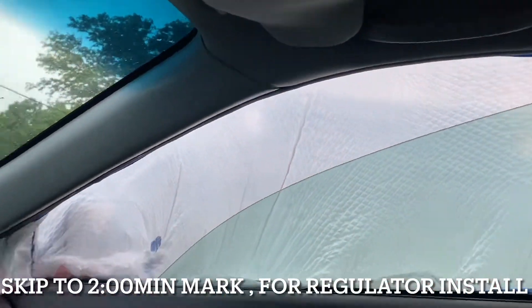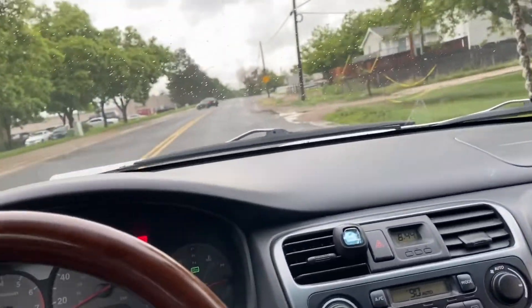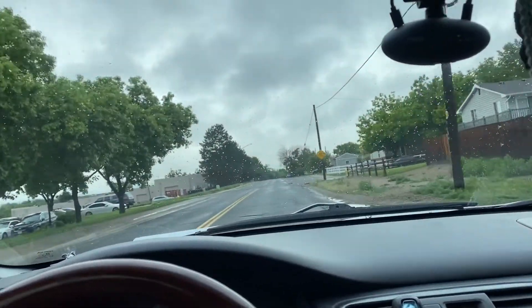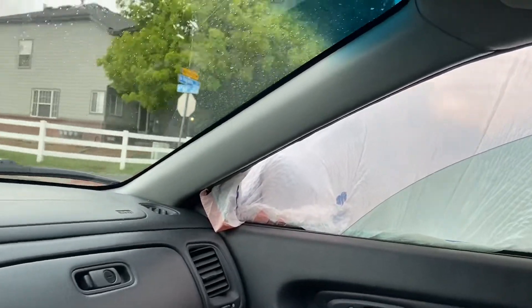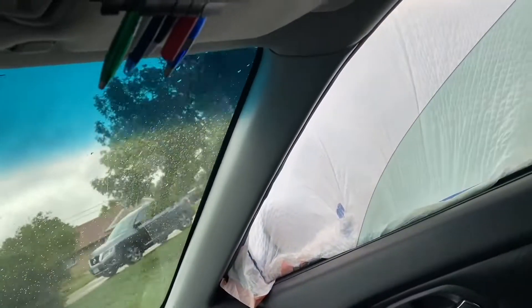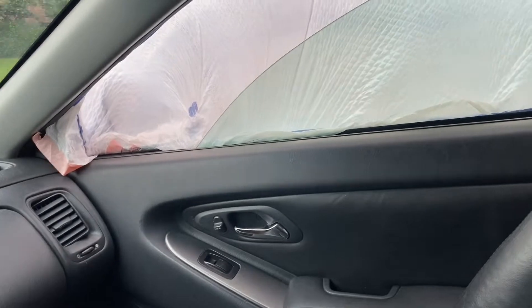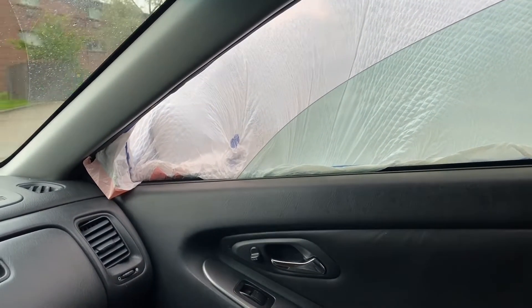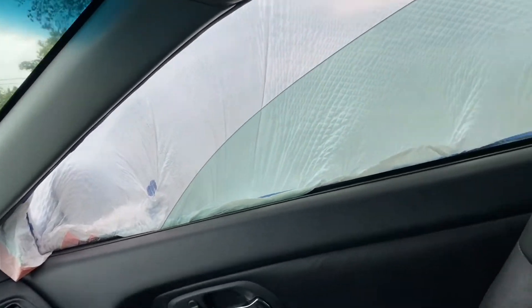Day in the life, taking the side streets over to my dad's. It keeps raining bad, raining slow, raining bad. So I put a bag on the window — I don't even have duct tape, that's why I'm on side roads. I had painter's tape. I could hear air getting through. I was trying to show what the window regulator sounds like when it's going out — like a machine gun basically. She snapped on me yesterday; I was holding the window, trying to push it up slowly.